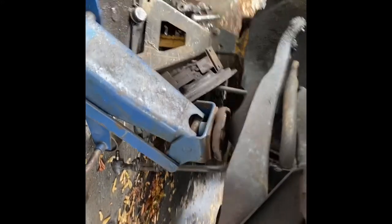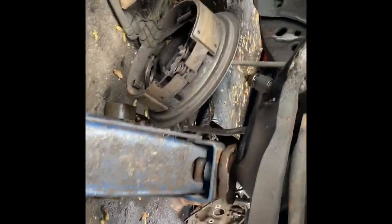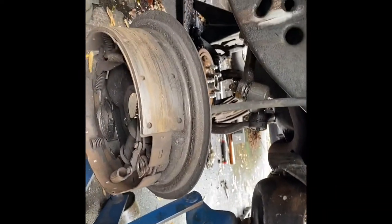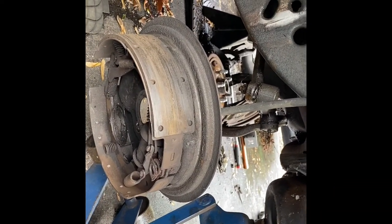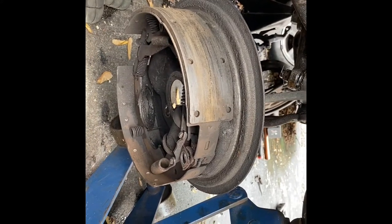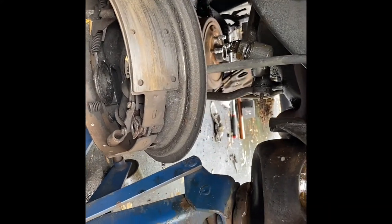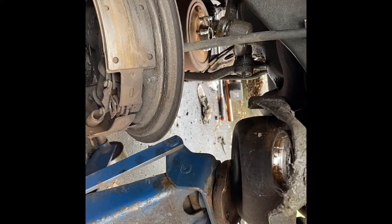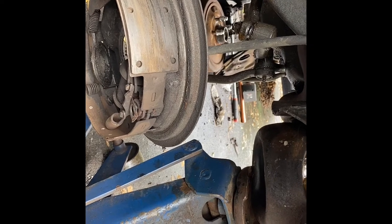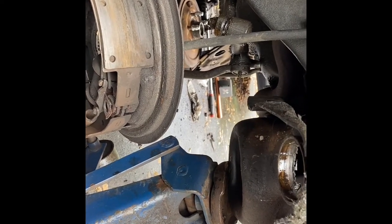What they sell you is a hub, the brackets, and they refer you to the calipers. The calipers and rotors come off of, I believe, a 76 Eldorado. I have all of those parts. That's the old drum there. Right now I'm installing the ball joints, and then I'm going to put the spindle back on it, put the coilover in, and then add the brakes.